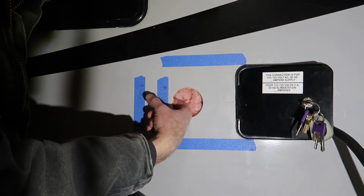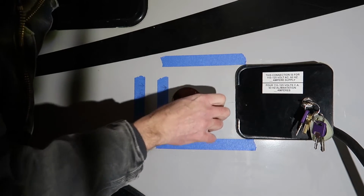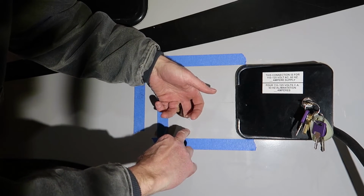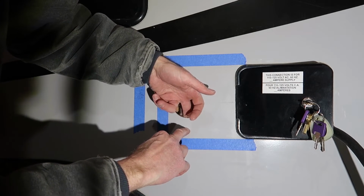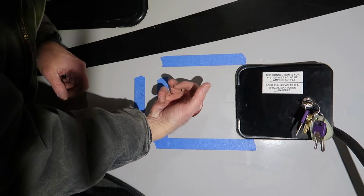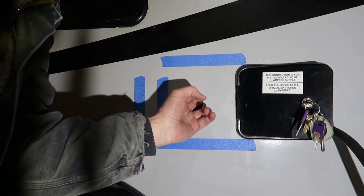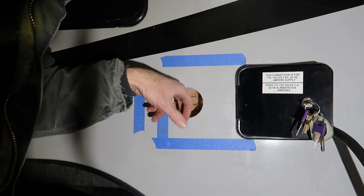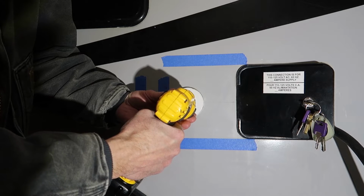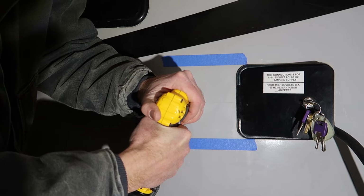And since we've got that wall stud right back here, I'm going to take this insulation, and there's actually a wall stud right down here. I don't think I ever thought to measure where that was, and I don't feel one up above. Just kind of stuff this insulation off to the side. Go ahead and insert this and try to keep your drill as square as possible. Then we're going to drill through the inside wall paneling.